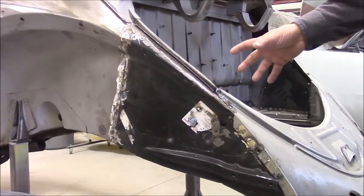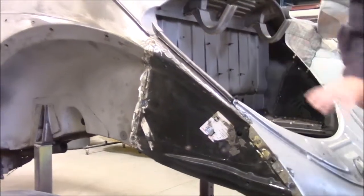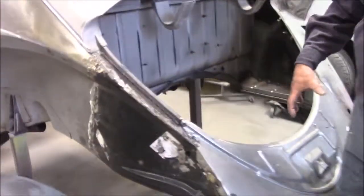We cut out the old piece, welded in the new, and then we dry fitted everything first, which is a really important step. So we dry fitted the fenders on, we dry fitted the rear apron because we wanted to make sure that everything lined up properly, and then there was a considerable amount of work that had to be done in the engine bay area.